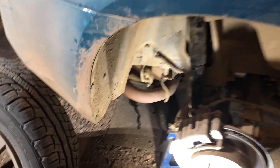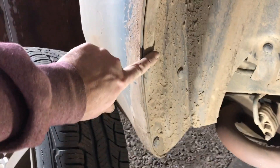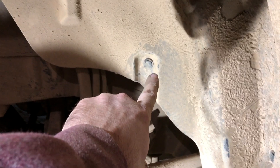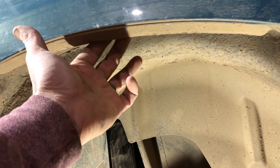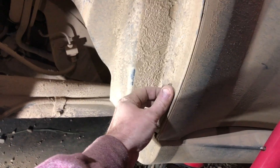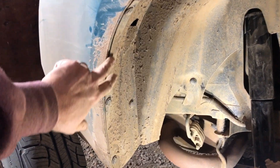There you go — one, two, three, four, five, six, seven, eight plastic rivets and then that sheet metal screw — what I mean is it's a nut made out of sheet metal on a little stud up top. It just keeps the top in there. Make sure this edge is folded under the plastic edge, and then it pops over here on the plastic bumper on the outside.